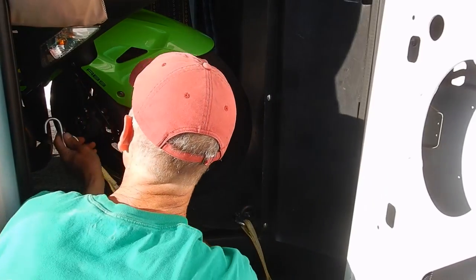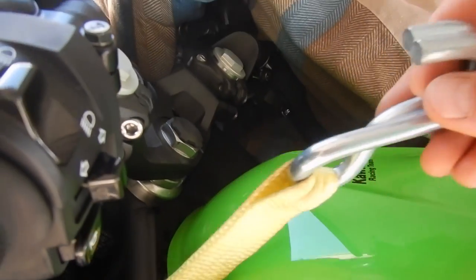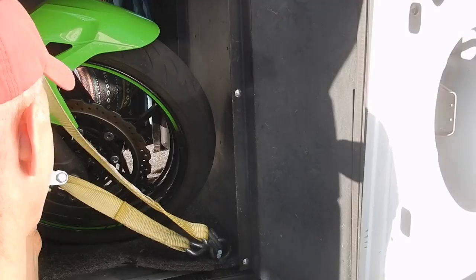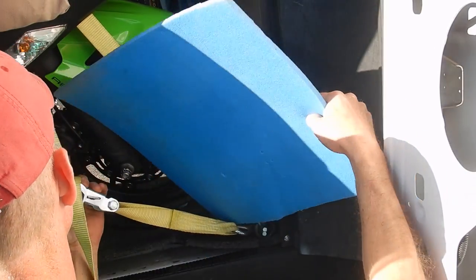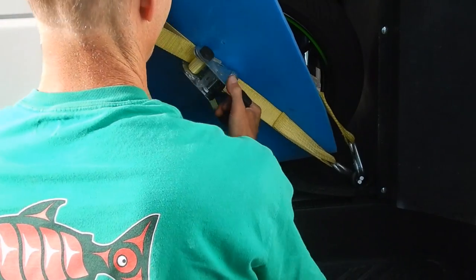I didn't dream up the following method for securing a bike to two anchor points — I follow the method shown on the MCN video here on YouTube, which you should watch. Run a ratchet strap behind the front wheel, up over the triple clamp in side-to-side fashion, and back down. Remove the key to eliminate any risk of inadvertently breaking it off in the ignition. Hook the strap on the front anchor and tighten it until there's no significant movement. I like to put a piece of camp mat foam between my bike and the ratchet to make sure I don't scratch or mar the fork.